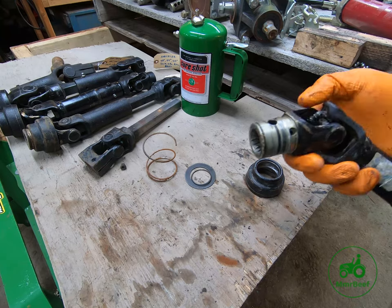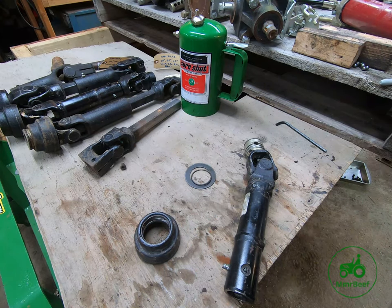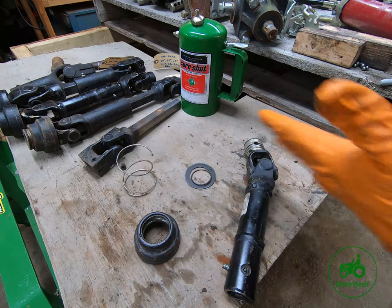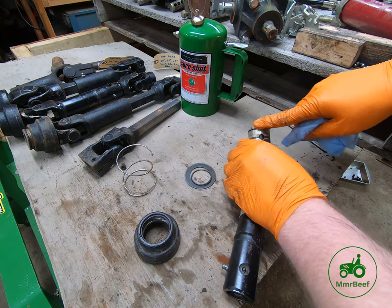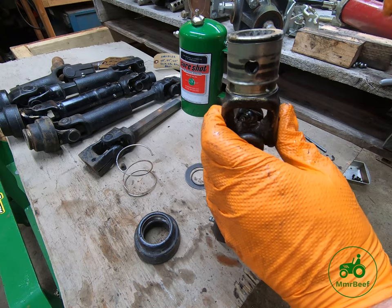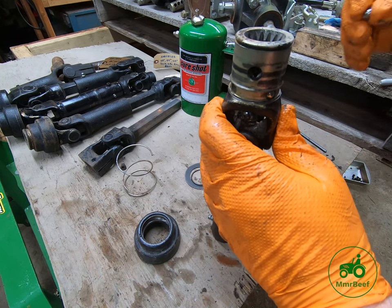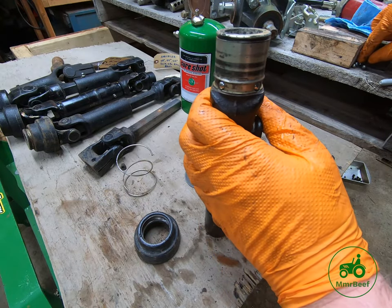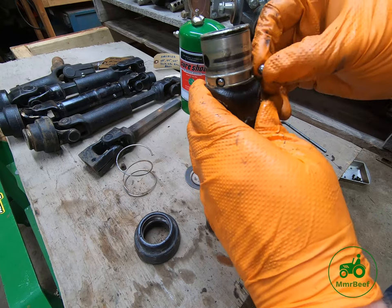All of our parts are cleaned up — the drive shaft looks significantly better. One thing I want to warn anybody against: don't use a lot of grease when putting these back together. Using grease will just cause the whole drive shaft to cake itself in dirt and dust, particularly on the insides. We're going to put the four balls in the bottom back in, and note I'm not putting any lube on them yet — if you put lubricant on them they're more likely to roll across the floor and be generally frustrating.